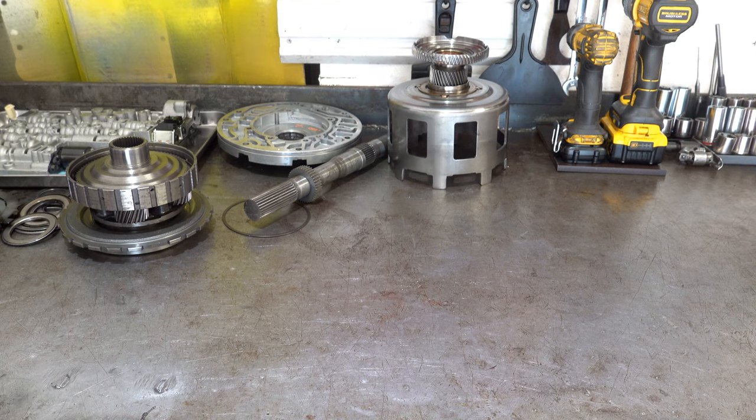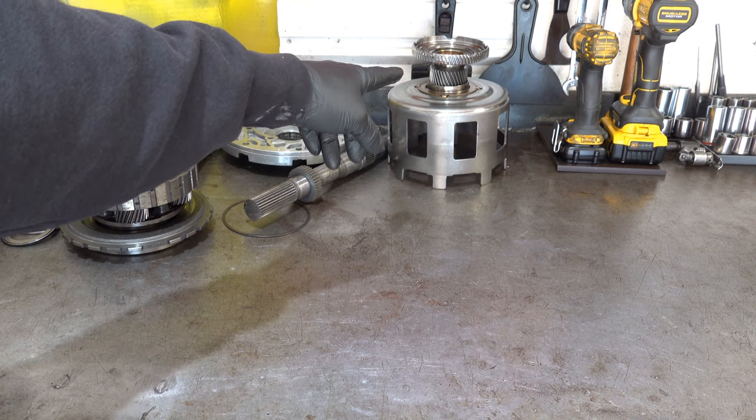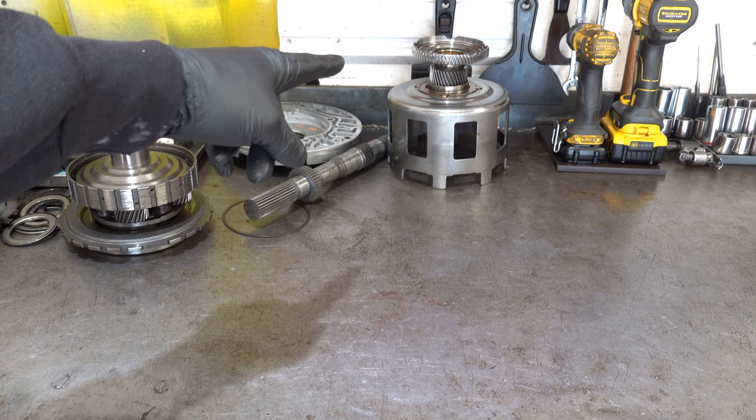Anyway, let's kind of close the loop and see if we can figure out what actually happened here. Because I'm reasonably confident that the initial point of failure was with those parts and the output shaft. And then whatever happened, in terms of subsequent collateral damage and secondary, tertiary effects, the forward clutch failure and all that, was triggered as a result of whatever happened here.